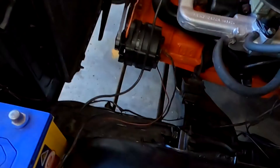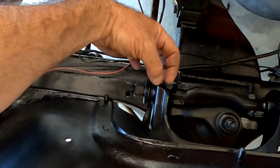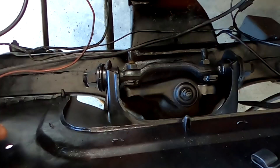These are the bushes we're getting out here. When you're undoing these two — and this will all come off as one piece — wire wheel these threads first to clean them up so the nut comes off and doesn't take all that paint and everything with it. When you're taking these shims out, just take note of what came out of where and put them back. You're still going to need a wheel alignment, but if you put them back where they are, you've got half a chance of a decent setup to get it to the wheel alignment shop.